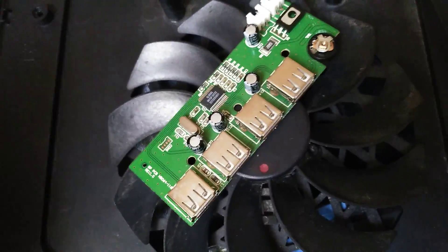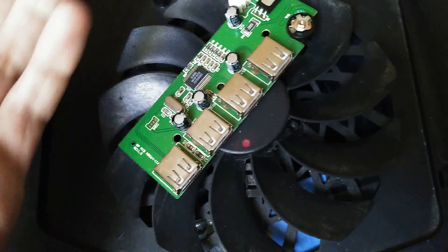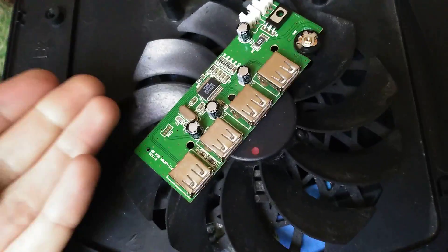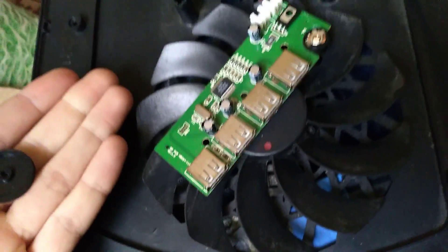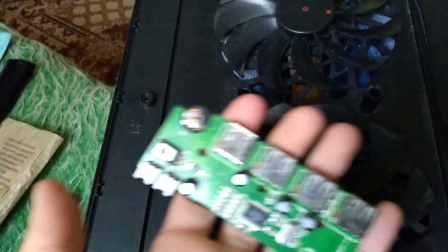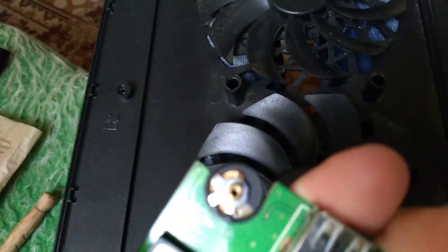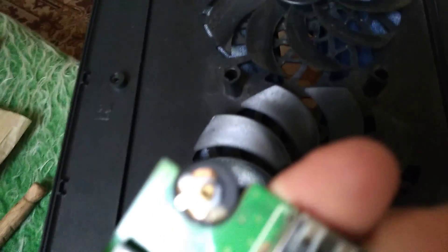Just like in the radio, when we want to turn the volume up, you turn it and we use more power to produce more volume. In this case, we will spin the fans more quickly. The issue is that when you use it for a very long time, there is some wear on the potentiometer itself and it creates dust particles that block it from making contact with the plate.